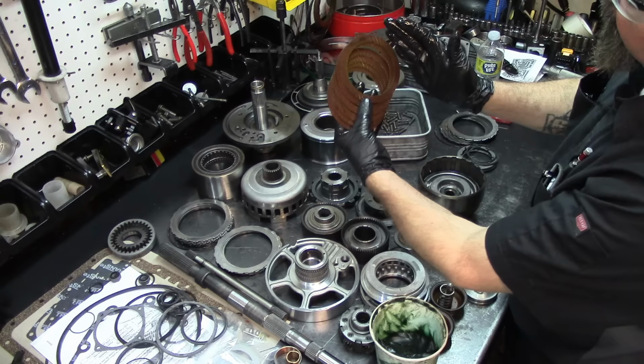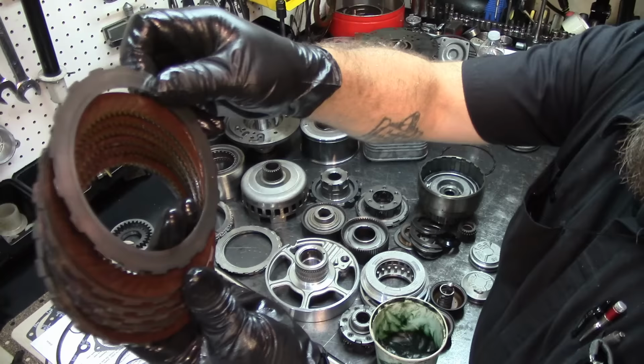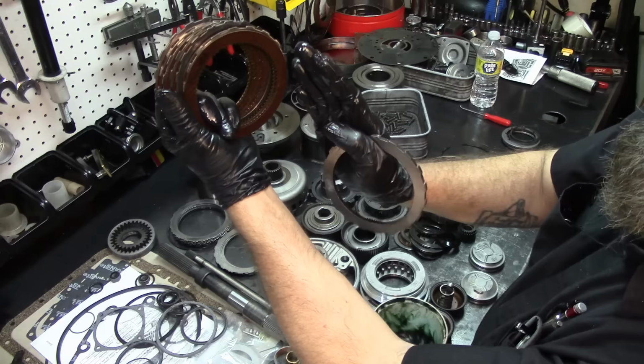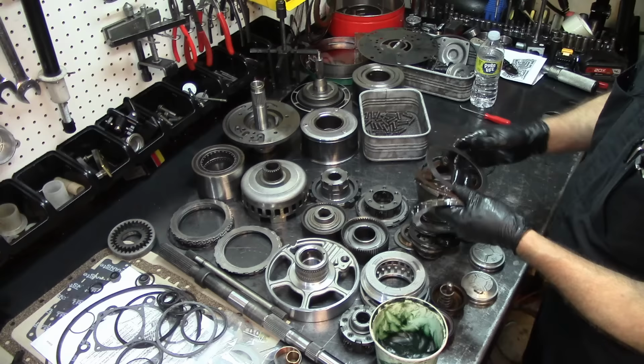So let's go ahead and install our frictions. This is a steel, and then we finish with our pressure plate. And as you can see, our grain on the forward frictions is to the left. And I think I showed you this on a 5R55S or W or one of those that I was doing